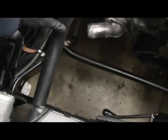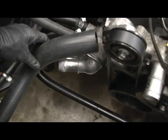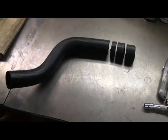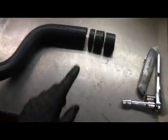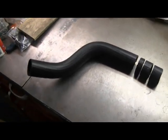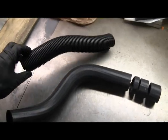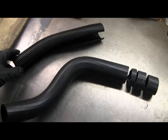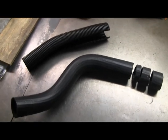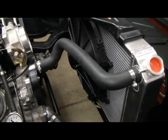Here's the lower radiator hose just set into place on top of the lower nipple — it's close, so I'm going to trim some off the end. It took three tries but I got to the right length — here's my first cut, second cut, third cut — and it fits really nice. It also came with a corrugated protector on it, which is great because it's really close to the frame and that'll help guard it. Couldn't ask for a much better fit.